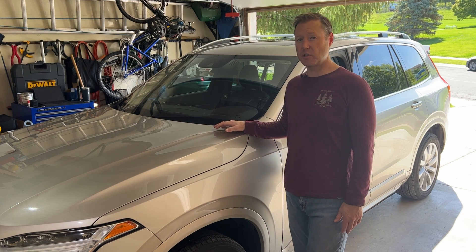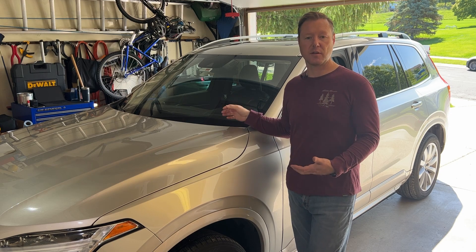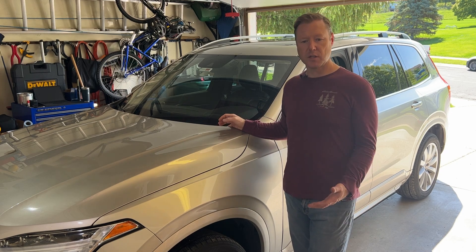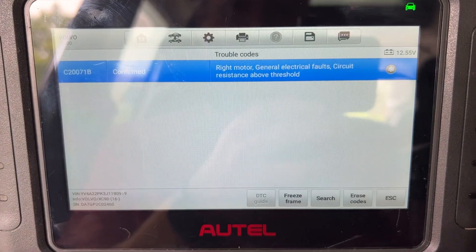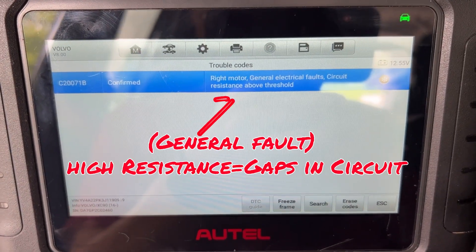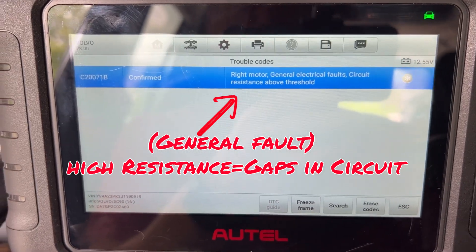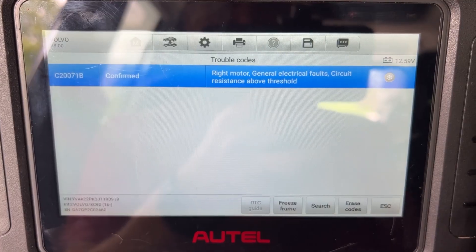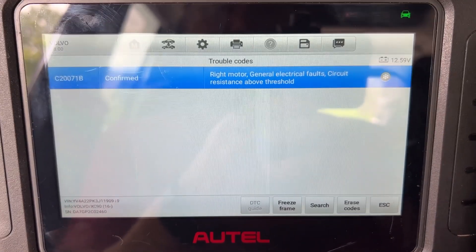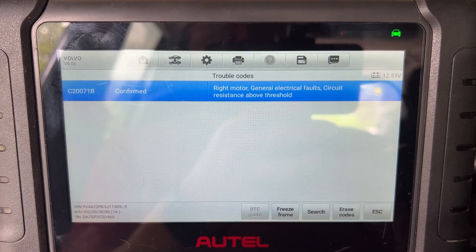I'm not so sure - I'm really hesitant to disturb that - so first I'm going to diagnose and see if I can find anything in the rear wheel like loose connections. This can mean there's just a break somewhere in the circuit, because what this is really saying is that the resistance is off the charts. You should read from this: check your wires, make sure there's not some open in the circuit like a broken wire.